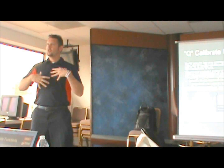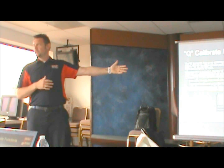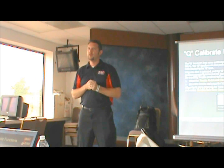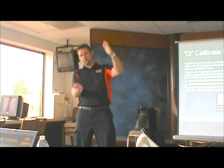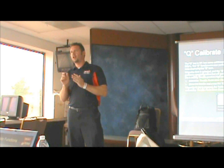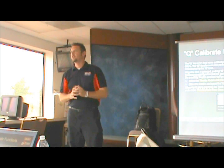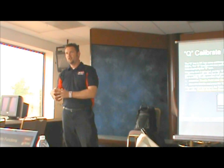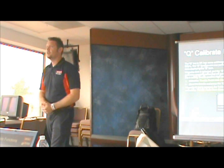So if you're a standard user, you're new to it, don't be intimidated by the 1,000 channels that are in that list. I've broken all that down to only the things that you need to use on a frequent basis. So you log in as a standard user, that list goes from this big to this big. It only has the tables that you adjust, the fuel tables, nitrous tables, boost tables, things like that you're going to want to use from a run-to-run basis. If you have some sort of an issue and you need to get to more advanced settings, then you can log in as an advanced user, and then the list gets this big again.